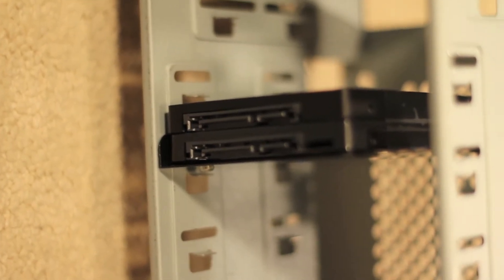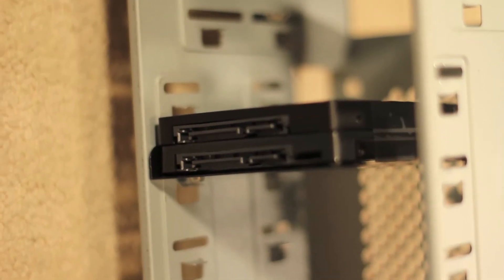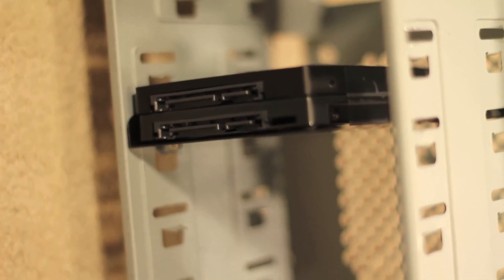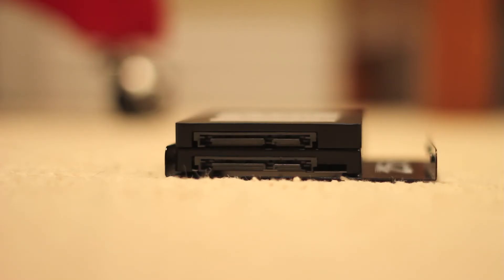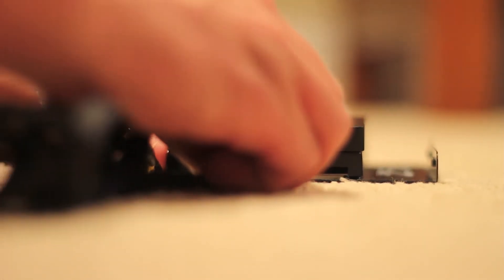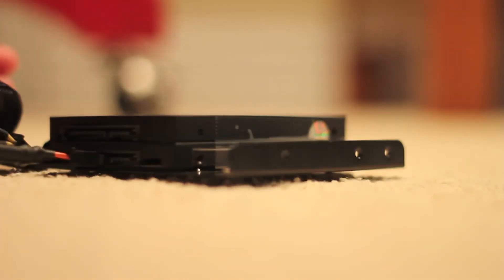It's just for demonstration purposes only. This should look like the end of a SATA cable — there should be a little keyed spot to the left. Now remember, I have two solid state drives, so you're only going to see one of these if you install them. Basically, with building a computer or installing any part, if they don't fit, it's not meant to be there. Just plug it in and if it fits, then it works. You install a SATA cable like so — line it up and simply plug it in. It should snap in, and that's how it should look.